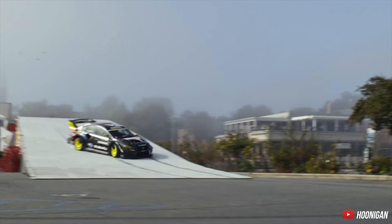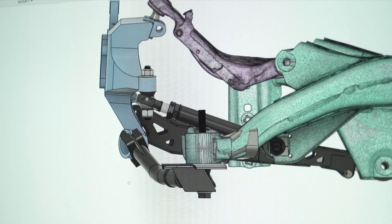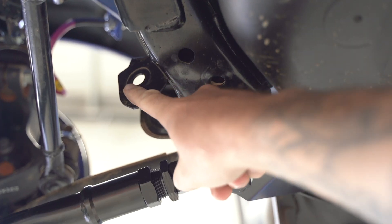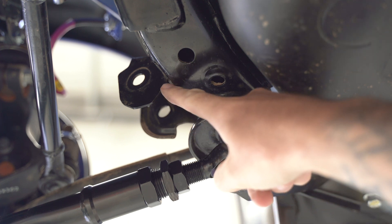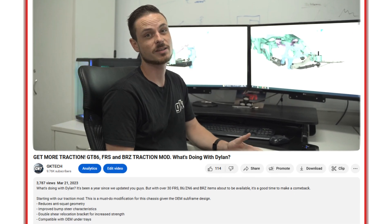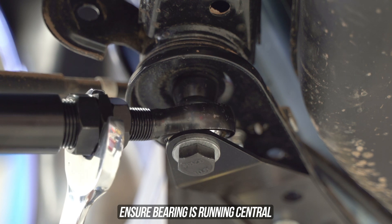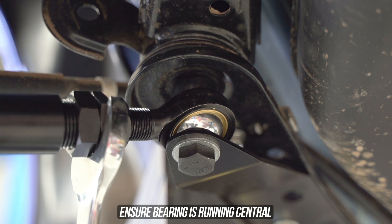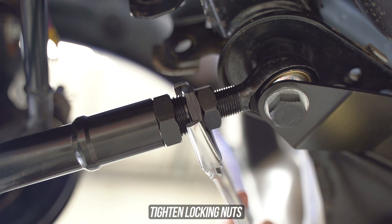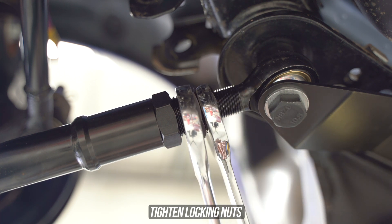From our research, we found that the subframe is mostly based off the all-wheel drive Subaru subframe, which has quite a bit of anti-squat. This is good for an AWD or FWD car to prevent lift in the front, but it's not ideal for a car that spins the rear wheels. By moving the position of the arm downwards and further forward — with the relevant bracing — we fix that. We had a professional model explain these in a more technical video, so feel free to check that out. Now, if you're a GK veteran, you'll know the bearing needs to run central — it cannot be cocked left or right, otherwise you'll damage the bearing. Because we've set our length and the bearing is central, we can lock the locking nuts up now. Wind those nuts on down, hold the extender with your wrench, and tighten one locking nut then the other, ensuring they're going absolutely nowhere.